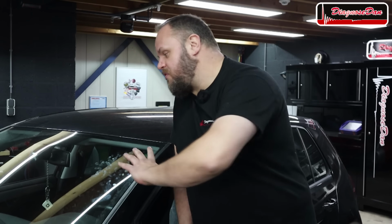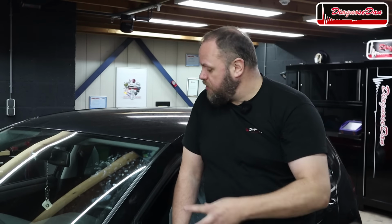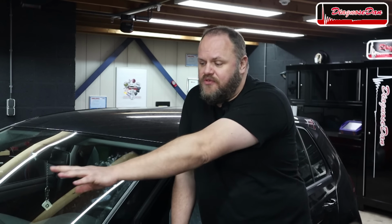I diagnose cars for a living, so when I diagnose a car I need to do this as efficiently as possible. To get to the bottom of this problem, first I have to familiarize myself with the entire system. Then I have to learn about the topology and ask myself the question, why is a fault code for a gear selector lever stored in the steering column electronics and not, for instance, in transmission? Then I have to find wiring diagrams, I have to do measurements, I have to analyze the measurements, and it could easily take me 2 hours before I know what's wrong with this vehicle.